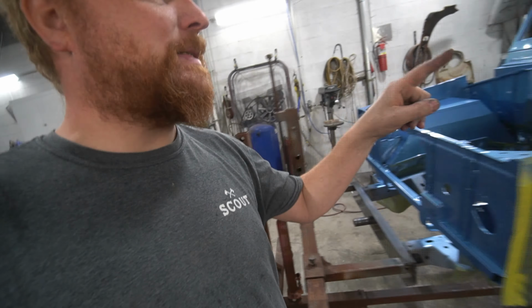Got this sanded down with 1,000 grit. You can tell when I'm talking about orange peel, my camera will pick it up. You can almost tell, like here, this was 1,000. It's textured, just like the peel of an orange. You can actually see that or not? There we go, get the light on it. The orange peel is caused by the atomization in your paint gun.